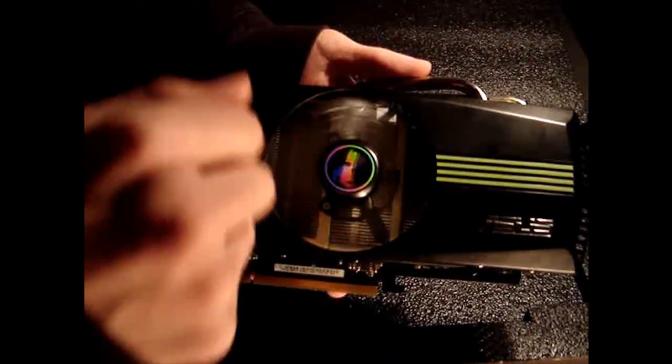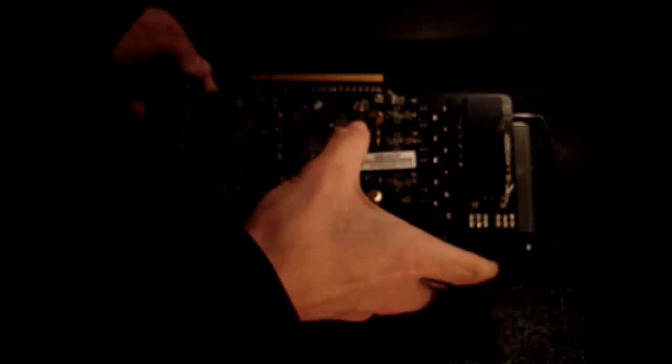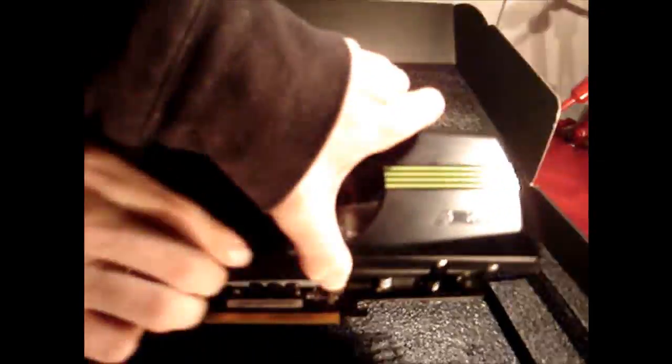Under the packaging is the NVIDIA GeForce GTX 460. You can see it has a nice flower-style fan cooler with the copper heat pipes visible inside. There's the PCI Express x16 connector, and the two 6-pin connectors you need to connect it to your power supply. You can see the power regulators on the back as well. Over on the output side, there are two DVI connectors along with a mini HDMI port that requires an adapter. And there's the fan connector.